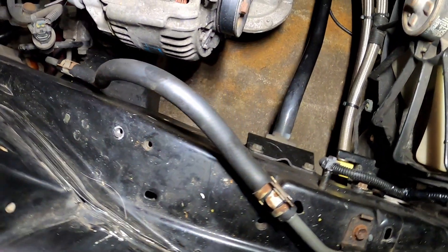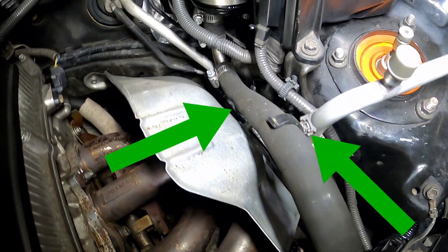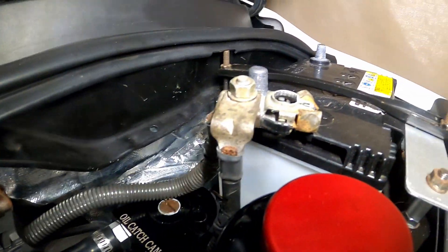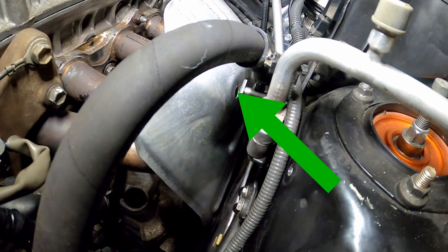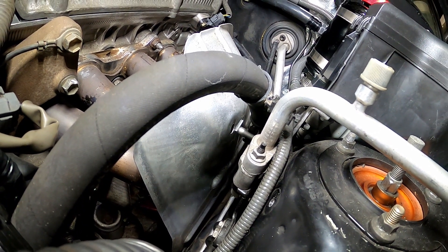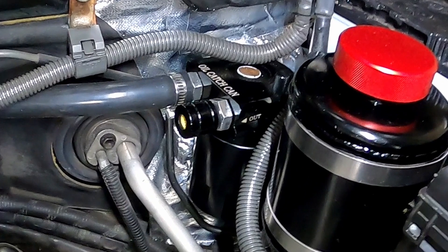If you know the Altezza really well, there's a spoiler alert here. And here it is all complete. You can see that I've got the main hose going there with two hose clips on it. I've got a different filter on here, allowing more space for the positive terminal. I will note that I had to drill a new hole to get the spacer in the position that I wanted. The bottom is in the standard location. There's the battery bracket — pretty rad. Check out this video to learn more about catch tanks, how I did this, and why.